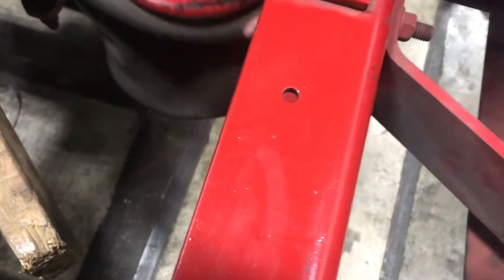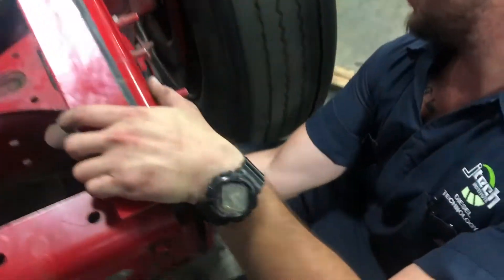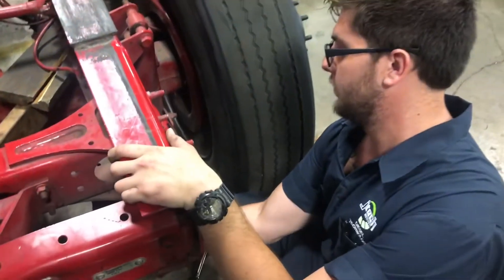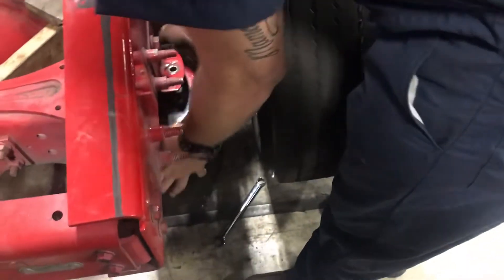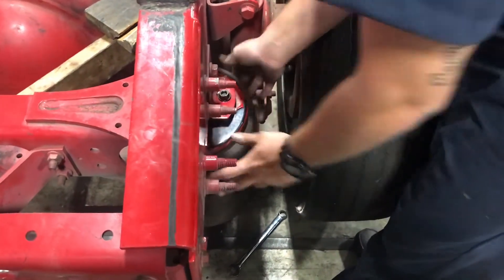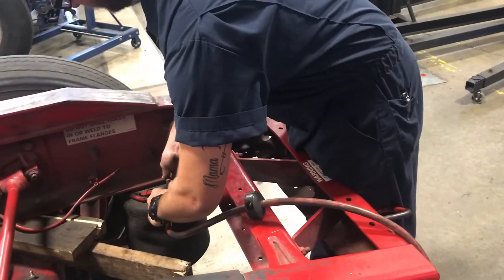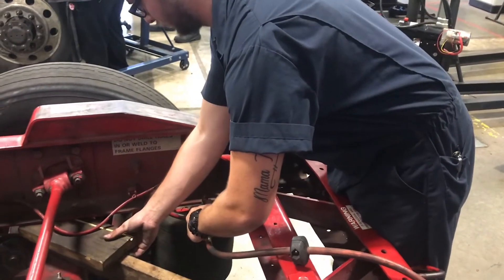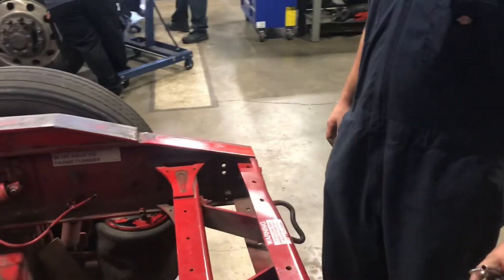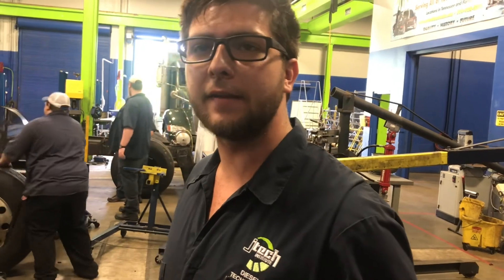To put it back on it's just as simple — line up your holes, put the bottom one in first and then compress with your hand, put the bottom nut on it, then put the top nut on. Now that it's in place, push it back up. All I've got to do is fasten down the airbag, reconnect the airlines, put air to it, leak test it — and it's called a day.